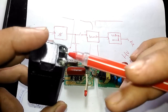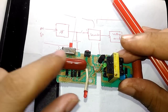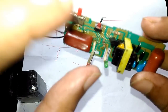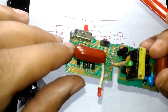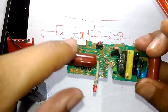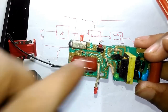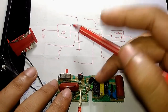If the battery seems okay but still isn't being charged, then the culprit is the charging section. If there is no input current going to the battery, it cannot be charged. The first thing to check is the capacitor dropper — if it has gone wrong it will appear blown or exploded-looking, so you can easily spot it. Under normal circumstances the diodes are fine; it is almost always the capacitor. If that has happened, change the capacitor, try to recharge the battery, and see if the bat starts working again.